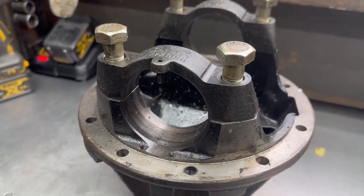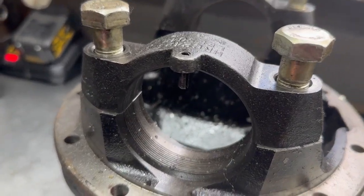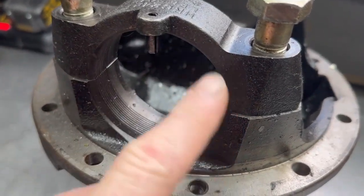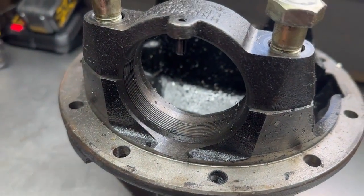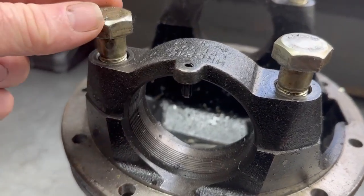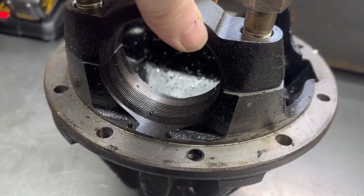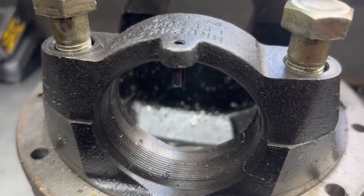This is an early casing. This pin has a habit of bending and shearing off, and there's a big adjuster ring in here. If it bends, your adjuster ring moves and changes all the backlash. If it shears off, the adjuster ring can actually unwind and come out. This is an early case — you can actually move this quite considerably; it's called shuffling. The problem with shuffling is it puts more strain on that pin. This was a real cost cutting exercise from Land Rover.